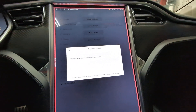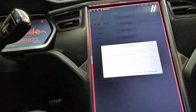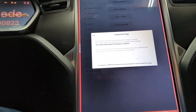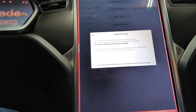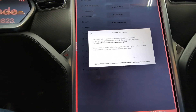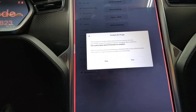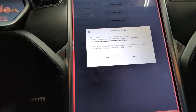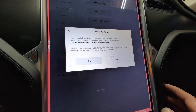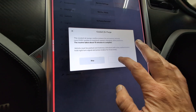In order to run the program, we have to unlock access to it. So hold the brake and turn signal for eight seconds, and then it will enable us to run this. It takes about 15 minutes — it's going to run the AC pump and all the coolant pumps at max flow. Here we go.